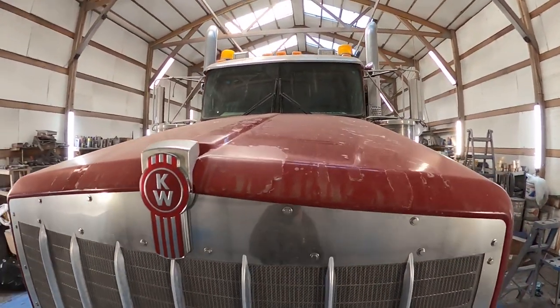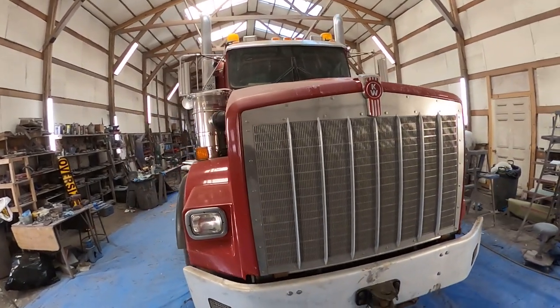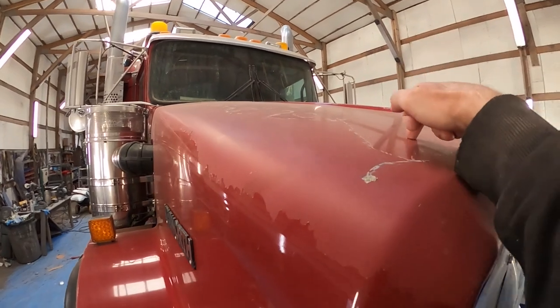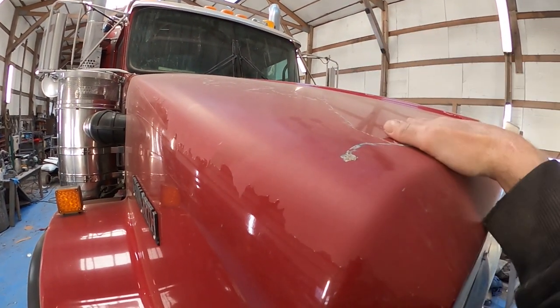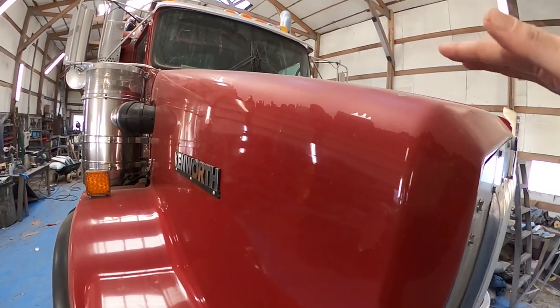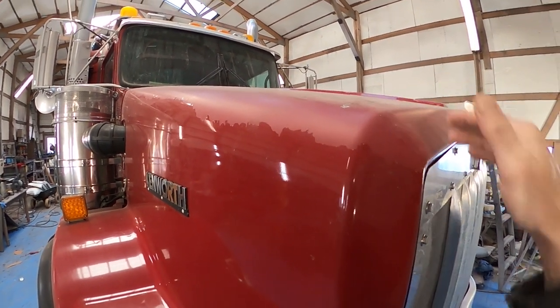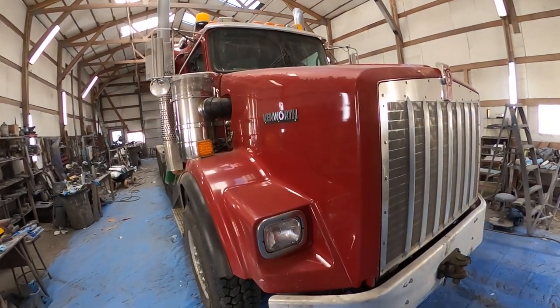That's a typical trick by autobody shops. They put one coat of clear on and sell it to you that way. And you don't know that in a few years, the sun is going to come through that clear, cook the paint below, powderize it, ruin the adhesion, and the clear starts coming off. That's why on the roofs and tops of paint jobs, the clear starts coming off. It wasn't that it wasn't prepped, it's that this is what always sees the sun. And that's why it looks the way it does.